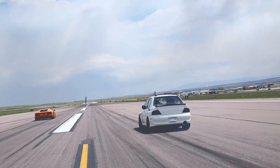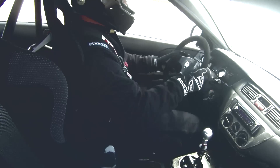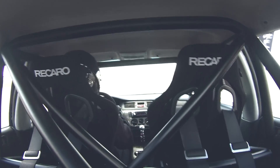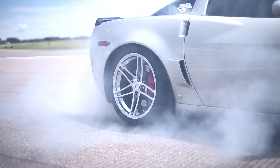This car was seeing a good 109 to 115 PSI of oil pressure at higher RPM, and we're down now to about 95 or 96 pounds. It also didn't compromise the idle oil pressure either — we went from 30-some PSI down to only 22 or 24. There's no doubt to me that this oil pump gear is the ultimate solution in the stock oiling system.